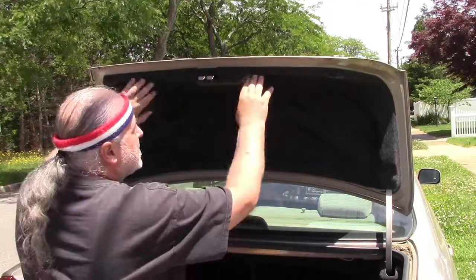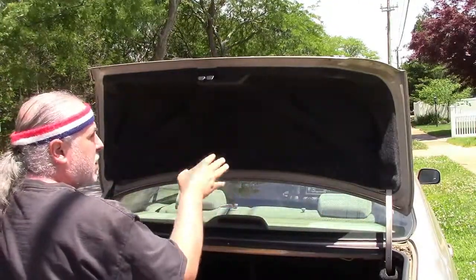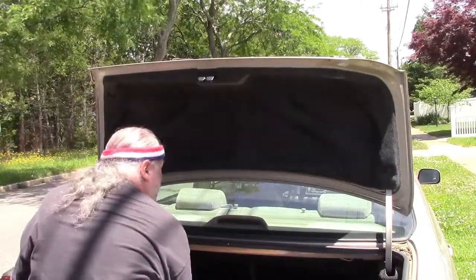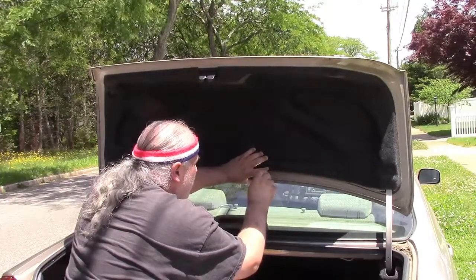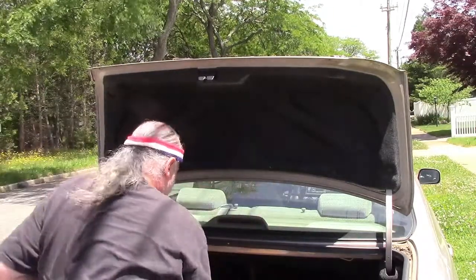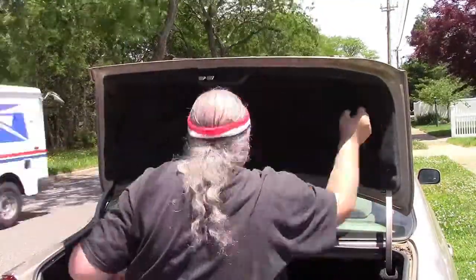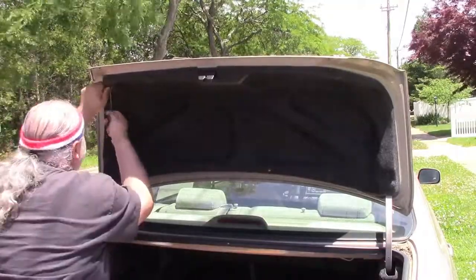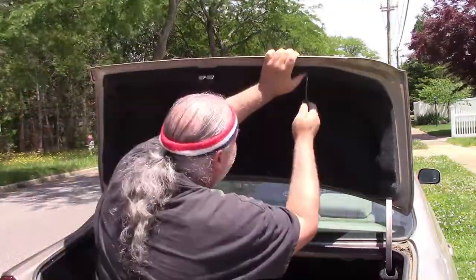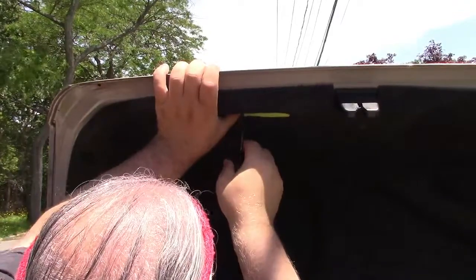You may be able to just remove some of the clips around here and reach in if you don't want to bother taking them all out, but just to show you better I'm going to go ahead and remove all of them. Put the Phillips screwdriver in there and turn it just ever so slightly — it goes right out and goes in your container. The last clip is under the emergency release, so it may be a little tricky to get out — but it just pulled right out.